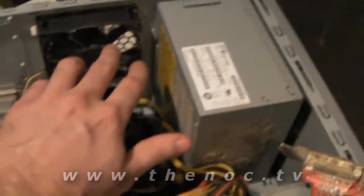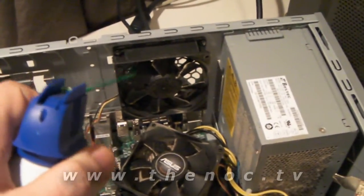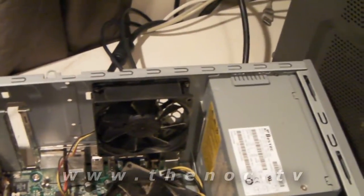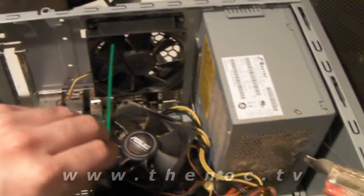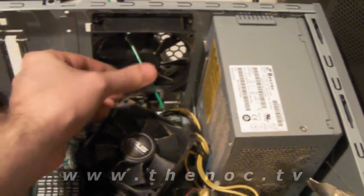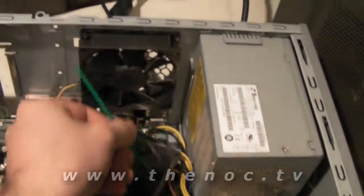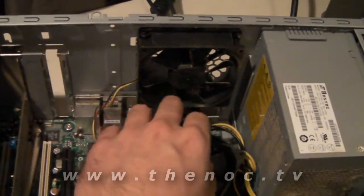Power supplies — just a can of air should do the trick. Same thing with the rear fans. Another tip: do not let the fans spin up. If you're going through and blasting the fan and you get it spinning really high like that, that's a bad thing. You can take your straw stick, put it in at an angle, brace it against something, and that way even if you really blast it, you can see the fan isn't moving. The reason you don't want it spinning up is that they're not intended to spin at such high speed. You can actually wear out your fan or damage it in that process.